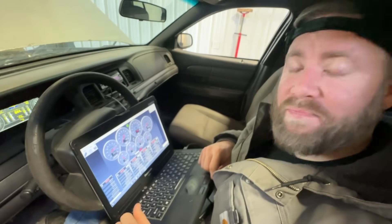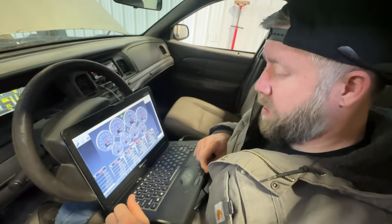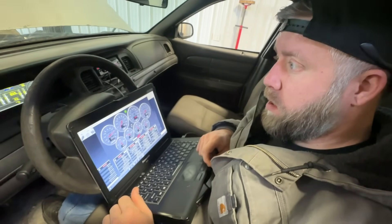Once you're done you just clear it and timing goes back to normal. We're within a degree, so we're not going to offset it at all. The farthest off I've ever seen is 13 degrees — that's brutal. In that situation you set it at 18 degrees and it was actually at 5 degrees, so we were wondering why the thing wouldn't make any power. At least it was on the safer side; it could have been worse.